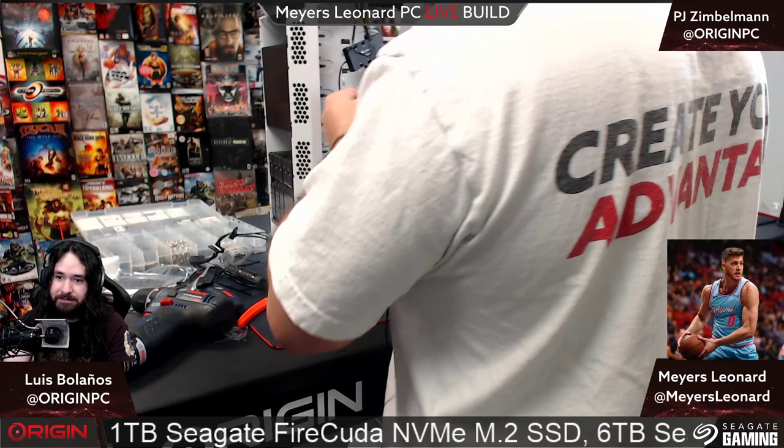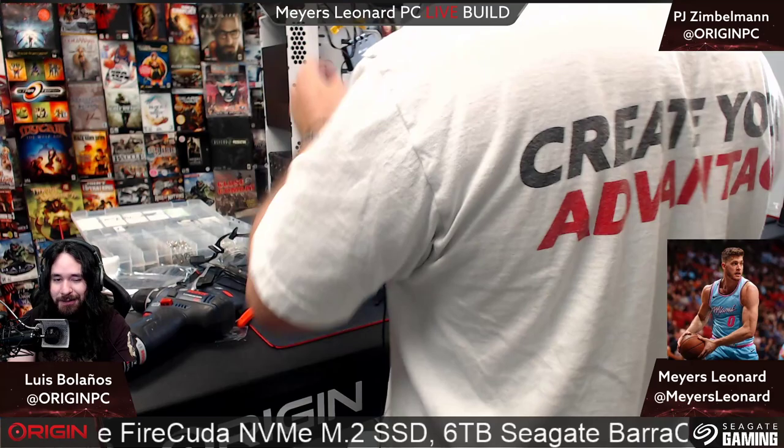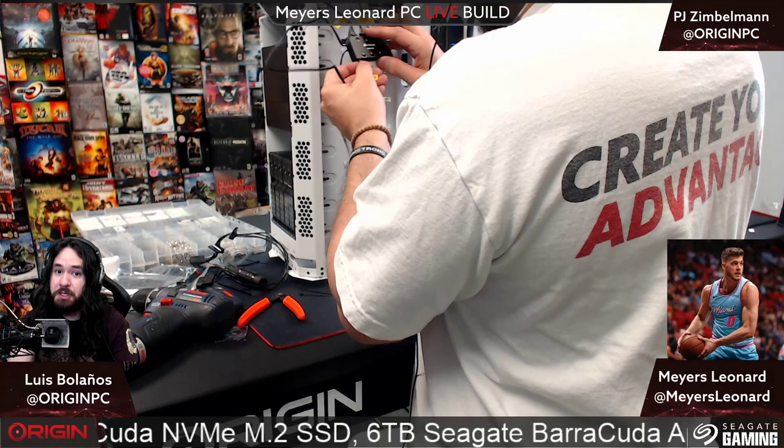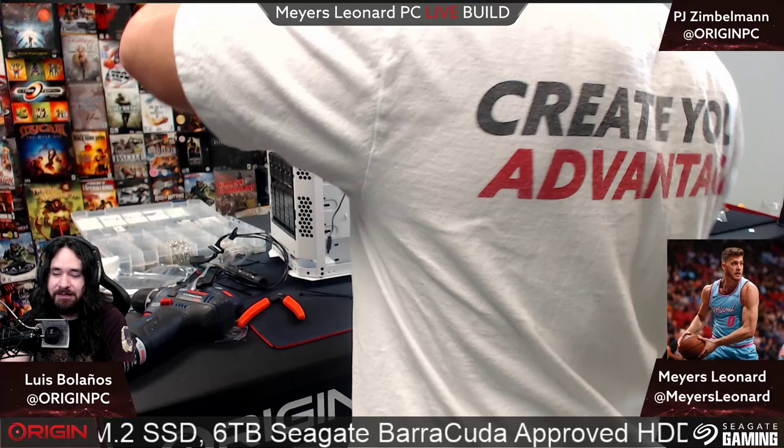Yeah, our variable mounting, definitely. It depends on your situation in terms of the aesthetic. It's mainly aesthetics, and in some cases airflow, because airflow is important in some PC builds. Especially where you put your PC, because let's say you put it in a corner against a wall, so you're blowing hot air straight into a wall. You might want that hot air blowing upwards. So that's one of the benefits of the variable mounting system. Got it.